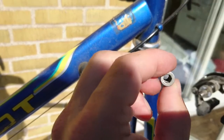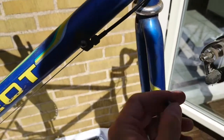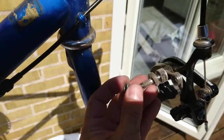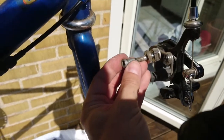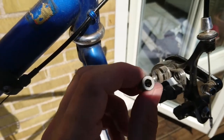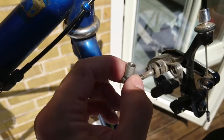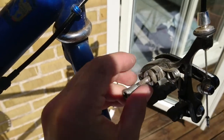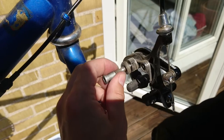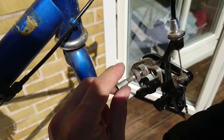This is what was sitting on the back side — the part I used the Allen key on. It goes into the fork, and there's a corresponding screw on the other side that goes through the fork and they connect inside the fork like this. Make sure that you keep everything and label it so you don't have a big ball of strange screws lying around. Keep all the brake parts together — front, rear — and label everything. I have lost many screws before, so don't think you'll do it later. Just do it when you do it, because you will lose screws.